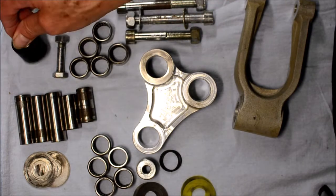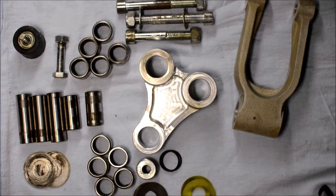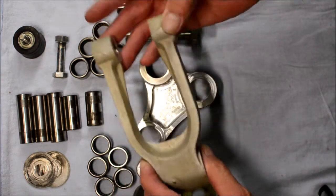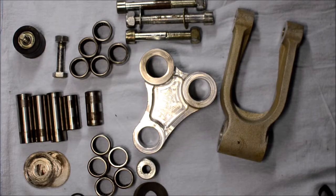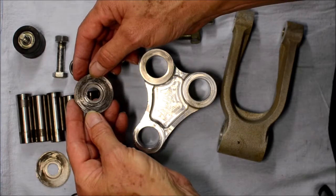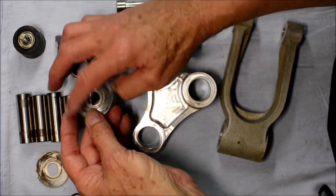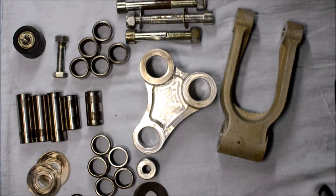This stuff doesn't survive as long as we're expecting. We have the troubles that Ian Moore will have experienced — even guys like Bruce; I reckon he'd want to check out the two bearings, especially the one at the back of the fork, and see how it's faring, because Bruce has got the most k's up of anybody in Australia that I know. What I'm looking for is some ideas. I'm sure I've seen on bikes — Suzuki and whatnot — where the washer has been big enough with an oil seal on the outside facing into the swinging arm.